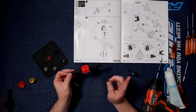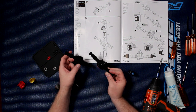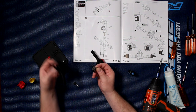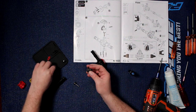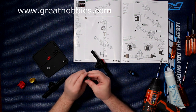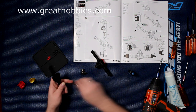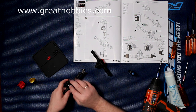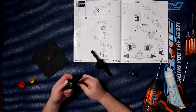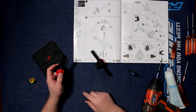We'll come back for another video to do part 2. You do have another one to do — your front and rear — it's just repeating the same steps. Basically, you rebuild your locker, pop your bearings on each side, pop your bearings in, pop your ring gear, pop your diff in, cap it, and you're done. And let's jump to step 2.